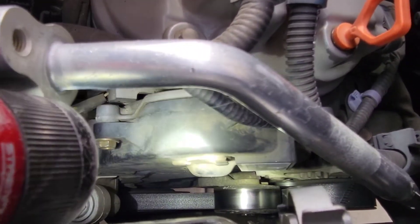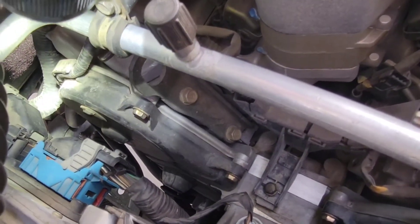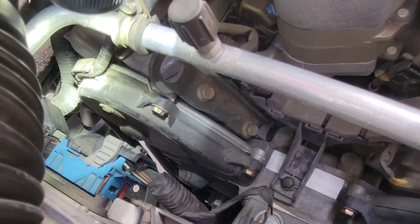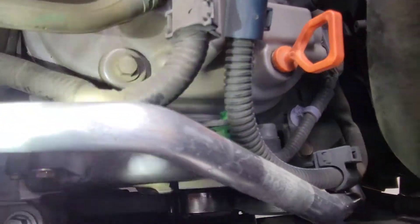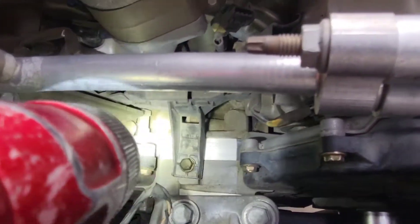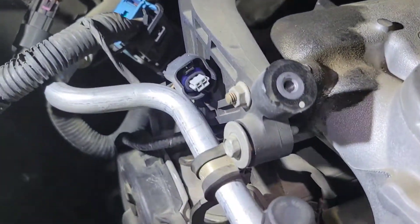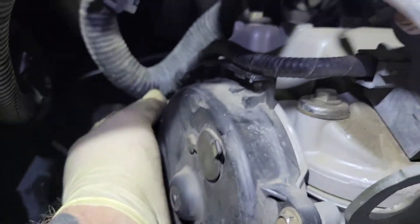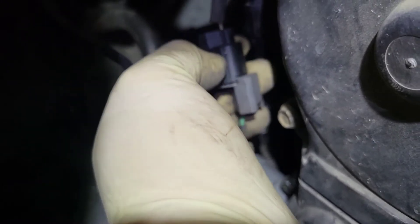Once you do that, you're going to take off this front cover here and that rear cover there. Now there's a wiring harness that goes up in the cover. You have to pop that out and probably disconnect some sensors back there to gain access. For the front one, the only thing you have to do is pop out this green clip for the alternator. Then you're going to support the engine and remove this engine mount. For the back cover, this harness sits in a slot in the rear timing cover and it's kind of tight to get it out. You're probably going to have to disconnect about three different sensors back there. Once you disconnect those, you're able to get it disconnected.